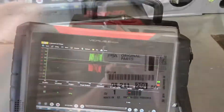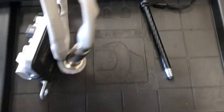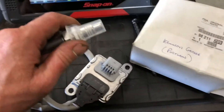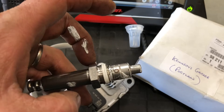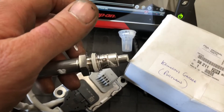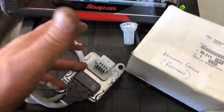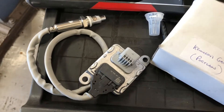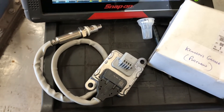It is in stock — there's a part number. I have all my stuff out again. Here is the module — to get a visual on the module — and that's the actual sensor itself. I believe they are kind of like two oxygen sensors tied together: a normal old switching one-volt type and a broadband, and that basically sends a signal into this module, which then sends a signal back up to show how much oxygen has been converted into NOX gases for the PCM. Car done — I'll do a little test drive in a minute and catch up with you again.